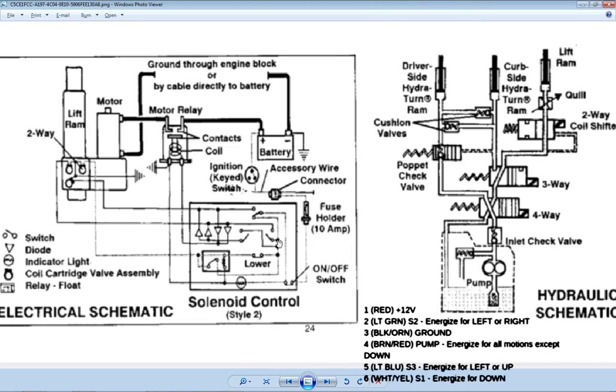When you hit the rightmost button — the right button — we connect 12 volts through a diode to turn on the pump, and we're also energizing S2, which is the light green wire — that's the three-way valve. Pump turns on, pressure comes out through the crisscross four-way, pushes out the driver-side ram, tilts the plow to the right, which pushes the curbside ram back in. Now this three-way valve is on, so it's a straight-through. Fluid comes back through here, back through the crisscross four-way again, and drops into the sump. No problem.